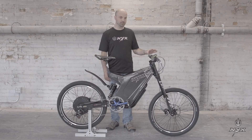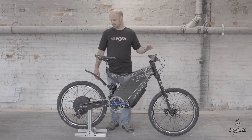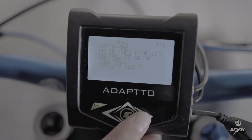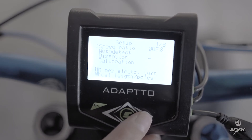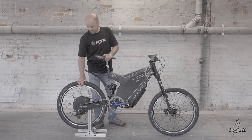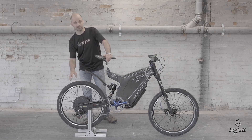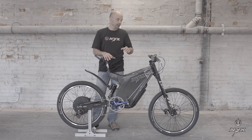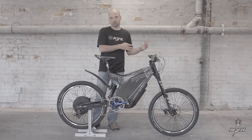Now it's time to adjust the speed monitor by setting the speed ratio parameter. Go to controller setup — the very first option at the top is called speed ratio. Enter a number calculated by measuring the circumference of the wheel in millimeters (about 2000mm) and dividing by the number of motor poles. Those motors are generally 23 poles, so you get a number around 80 to 85. Enter that number and the speed displayed on your monitor will match the actual bicycle speed.